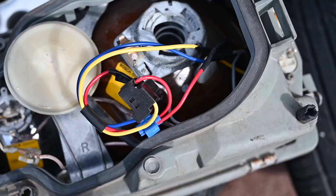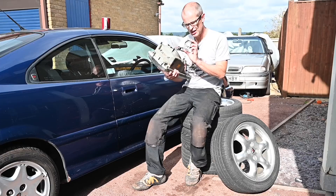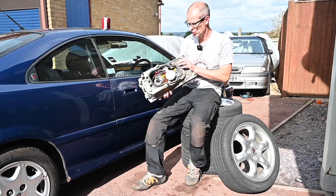Very boring — about an hour of me sitting here with a soldering iron scratching my head. Not great TV. But the headlamp holders, the bulb holders, are incredibly tight. I've had to go and buy some different H4 headlamp bulbs in the hope they will do up. They don't want to clamp in — they seem like they're too small a hole for the H4 bulb to go into. Maybe that'll work out later on today.